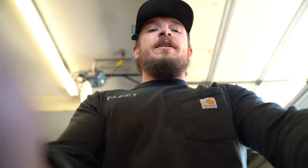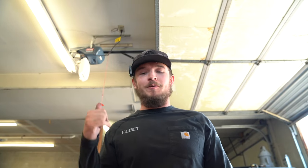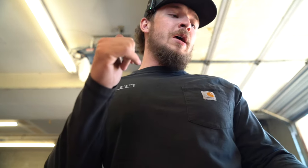Mr. Austin's gone. Huge thank you to Mr. Austin for coming out here and helping me. I don't claim to know it all, and I definitely don't with transmissions. I think we wrapped up with being able to get pressure to like 120-ish locked. So it's higher. Fourth gear still delayed, but when fourth gear hits shift now, it's very solid. As you guys saw, what came out of that pan and the filter when we took it apart, definitely not good. So hopefully we saved it for another season, but I think she's on her way out.